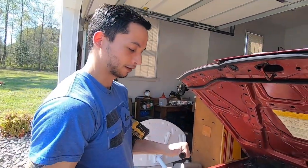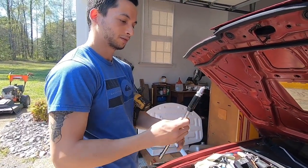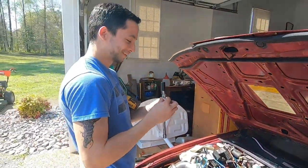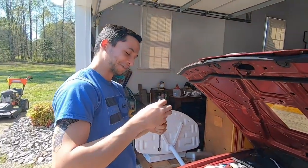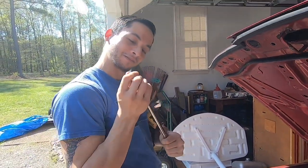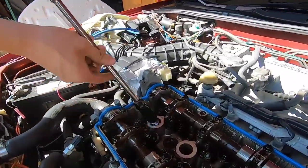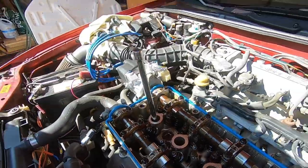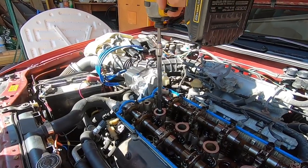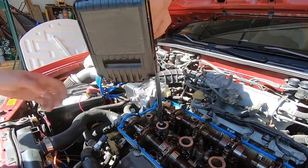So now, when you set it in, just go ahead and line it up. Stick it in with this. I didn't push it enough. All right, go ahead and get it lined up with your spark plug socket. Just kind of push it in so it's nice and seated, so that way you can guide it in there and it won't fall all the way in, which is important. What I'm gonna do is just get it threaded, and then when I feel more resistance on the drill, I'm gonna slow down. Like right there I feel resistance, so then we can pull.